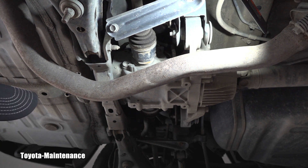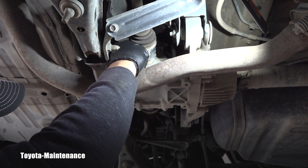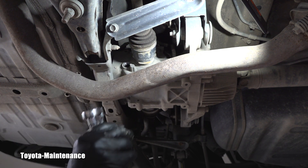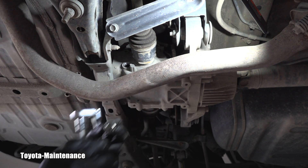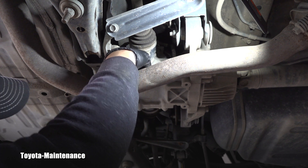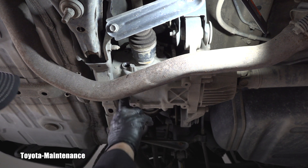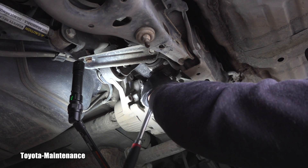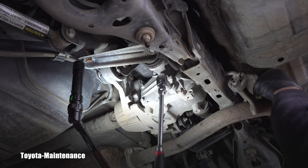Let's try to crack it open — not so bad. Now I know I can start draining. I'll open the filler anyway so it drains faster. Here you can see the drain plug with the washer. The top ones never have a magnet — normally just the drain ones. The level is slightly low. I did touch the level of the oil, so it's probably sitting right there. I'll say this is a reasonable level — not too low. Let's continue with the drain. I'm using only a 3/8 ratchet.